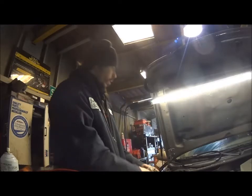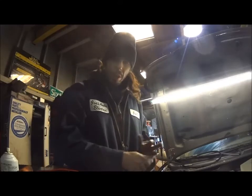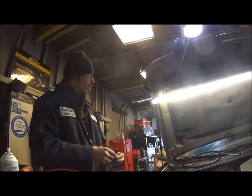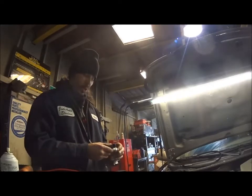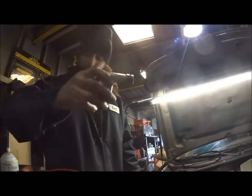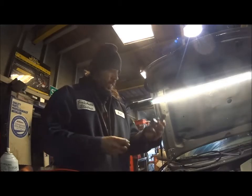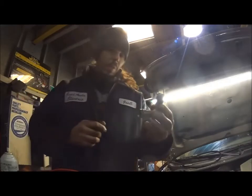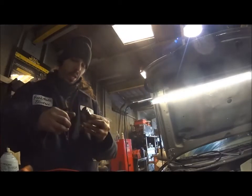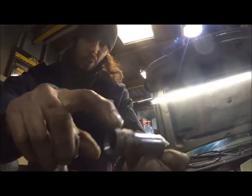So we moved on to this Buick here, which had intake manifold gaskets done some time ago. Well, let me see. What are we in? January. It was done in September, and when they replaced the intake manifolds, they also replaced one of the elbows on the manifold that goes to the tensioner on this car, this design. And I don't know if you can see this too good, but this O-ring is completely flat